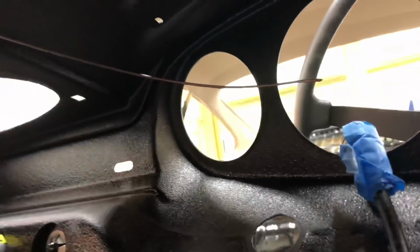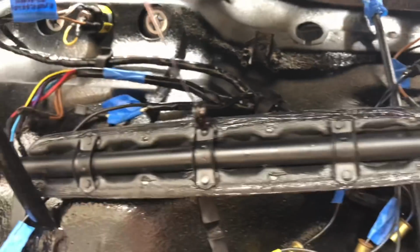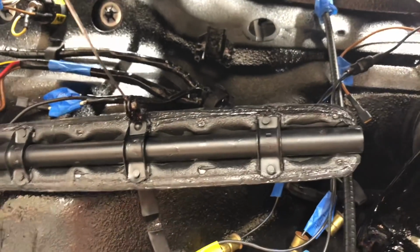Okay, I've got to pull it completely through there, and then now you can see inside the chamber there, the knuckle is coming through. So I'm going to pull that straight down now, and I'm going to hook the flap onto it. Okay, so if you follow the cable from the back through that tube, straight on down, and then we hook it under the flap, that's the position the flap's going to go in before we lift it up into that cavity and put our dowel pins in there.